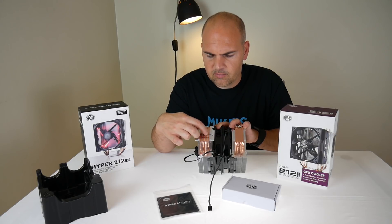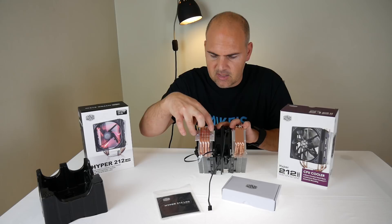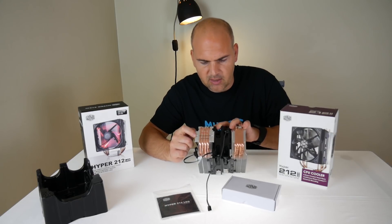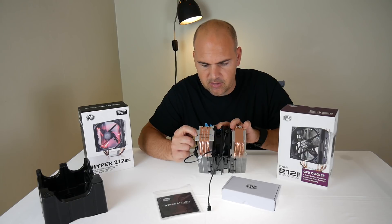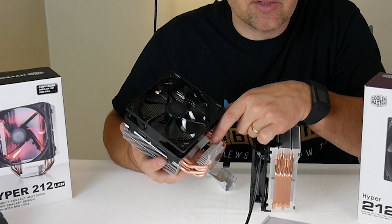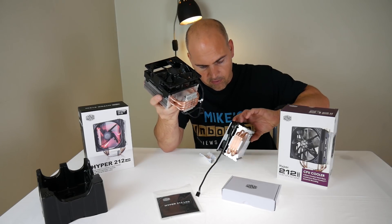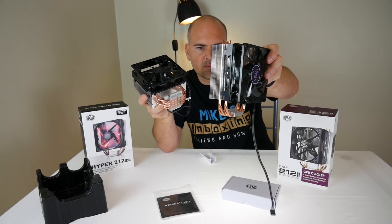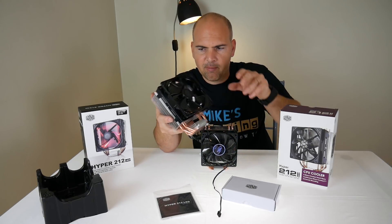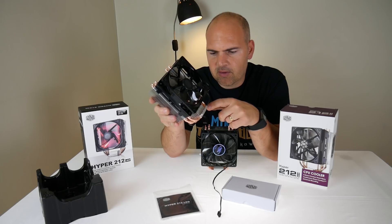Whether or not that's going to be still as effective a cooler remains to be seen. The main difference is this base plate — completely square piece of aluminium on the old one, whereas this one is more machined looking, with additional holes on the side for attaching mounts. From this angle you can see there's a slit cut out of the fins on the top, which is an improvement on the single solid block. I'll try and get some close-ups in the B-roll, but there's definitely an improved design on the CPU contact area.